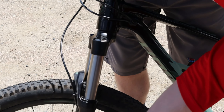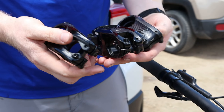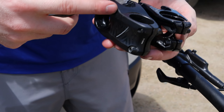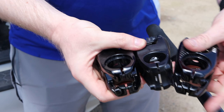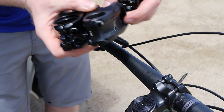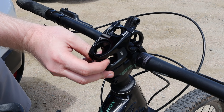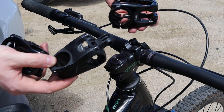There's still a little bit of crud in there — see the dirt coming up. What we're gonna do is take this WPL fork boost. What this is gonna do is help lubricate the seals a little bit. We just get it down in there and see all that crap it's bringing out. Oh my goodness, that's bad. Yeah, that's the stuff that's making it down into your seals. It's just an inexpensive fork — those are the compromises you make with cost. That was all the good crap that was kind of in your seals there.